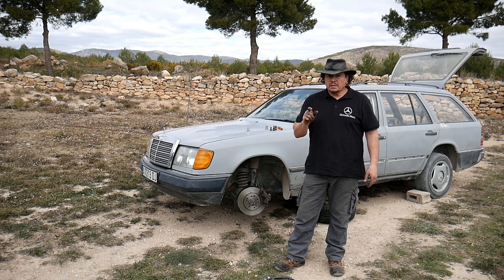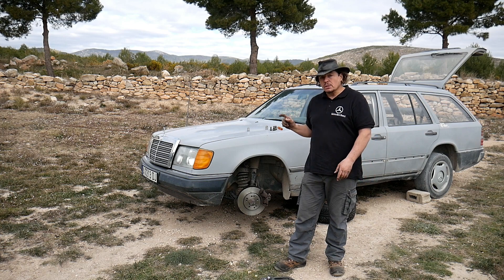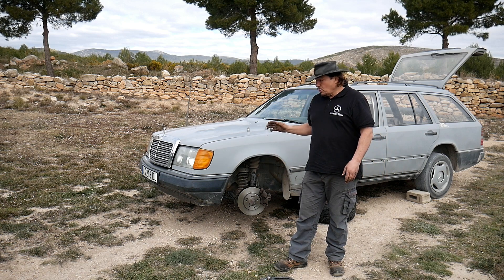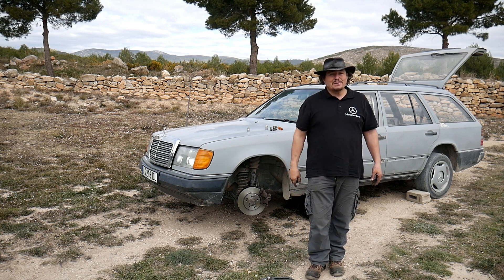Now be very careful, because the brakes have been slightly opened, remember? So they're not adjusted onto the brake disc. So before you go and drive the car like nothing happened, just press the brake a few times so that the caliper will adjust again on the brake disc. And that's it. I hope that you have liked the video and I hope it's useful to you. Until the next video, take care.